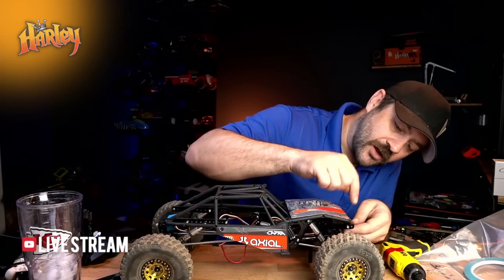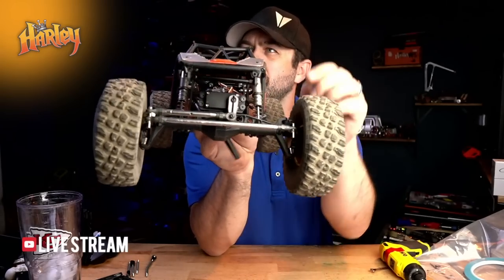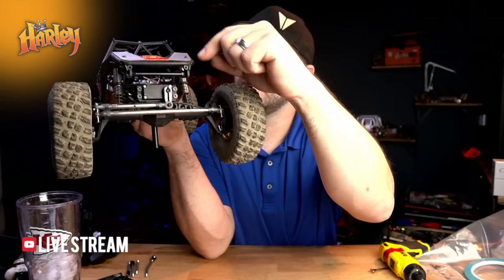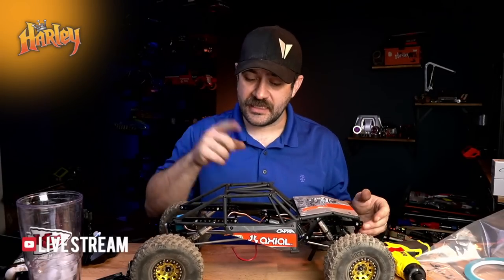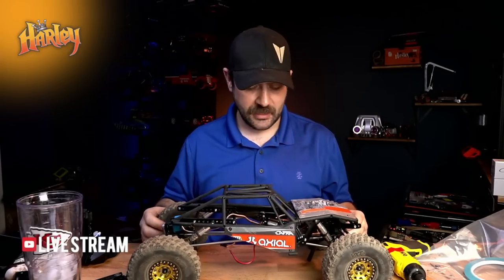And our hood is also going to drop down about 4 or 5 millimeter. You can see the front little contact points there aren't allowing this to go down yet. So I'll cut that even with the front tube bar so it drops down. But that will make that easy. Rear high clearance link, yep, these will get bent. These are just what we had, and they're not exactly the right length,